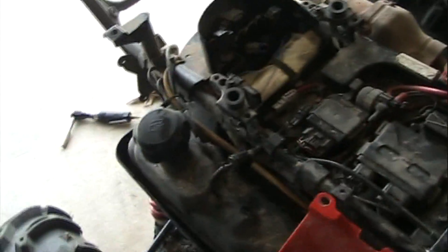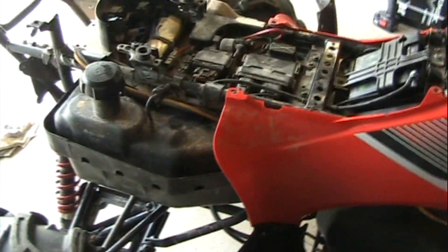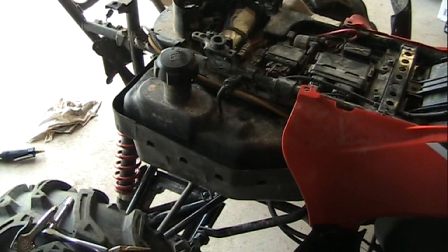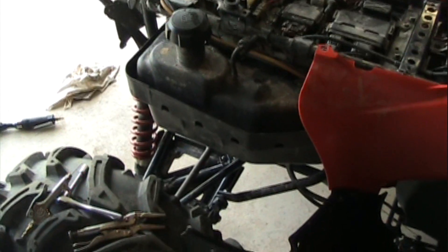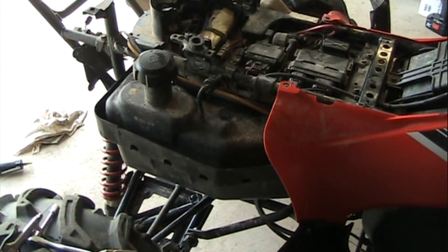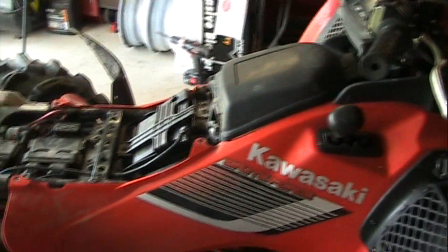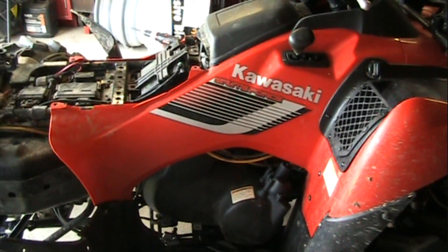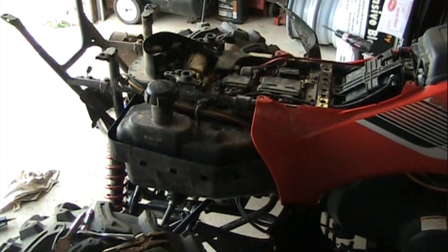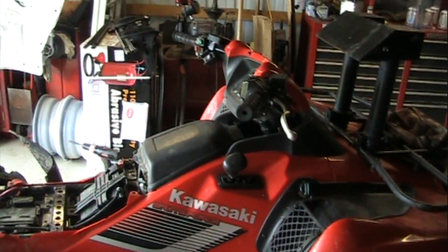The original standard issue with most of these 750is is loss of power at high RPM or high speed, and I was having the same issues. Eventually I figured out it was the fuel pump — even though it would put a decent amount of fuel into a coffee can and showed the appropriate flow rate when I let it pump for about 15 minutes, once it got pressurized for about two minutes it started to cavitate and wouldn't push any fuel. It was causing serious backfires and only getting about 20 miles an hour out of the machine. So I went this route, and like I said, it runs — bypassing the fuel pump control of the CDI.